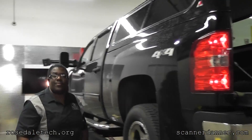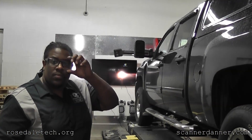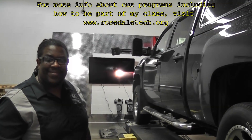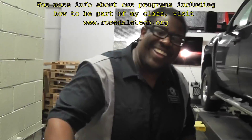All I'm going to do now is set my tire pressures to what the door sticker says, which is 80 in the back and 60 in the front. That's it - that's how you relearn tire pressures on a GM. Thanks for your help man, appreciate it.